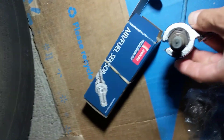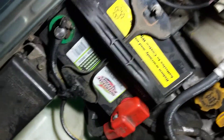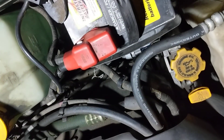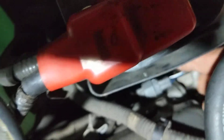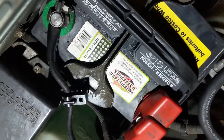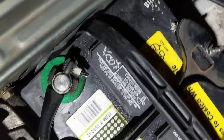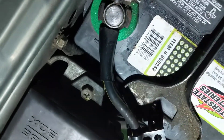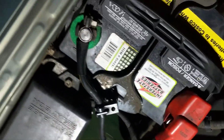You will have to detach the cable and feed it through an eyelet down there — you just press it and remove it. It's easier if you remove the battery first, and since you're working with the electrical part, you should disconnect the battery anyway. To remove the battery: remove the terminals, the hold-down screws, and lift it out.